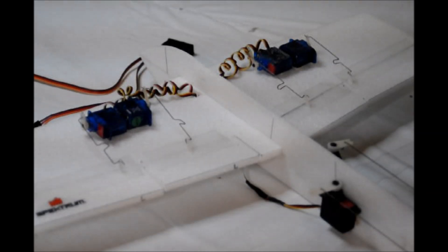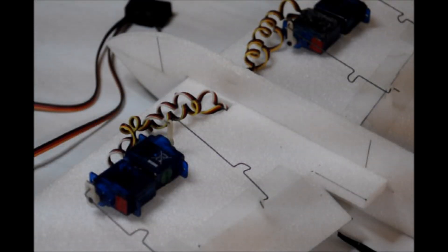At this point you will need to set up the plane with all servos centered except the flap servos. They need to be set at zero centering for now with no trim adjustment made in any flight mode. Here we have our servo sim with the servos fully exposed and you can see the servo arms in the neutral position. Note that the flap servos will most likely require offset to take advantage of the full servo arm movement. I will now offset the centering of the servo using the offset function found in the camber system menu.